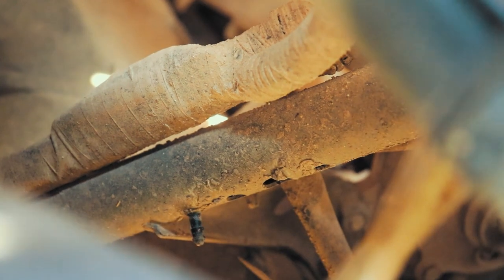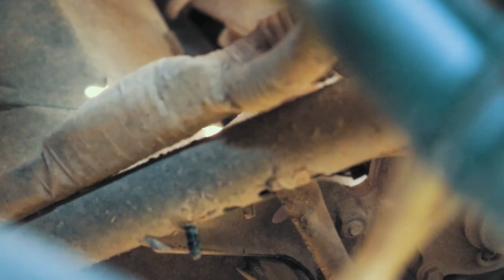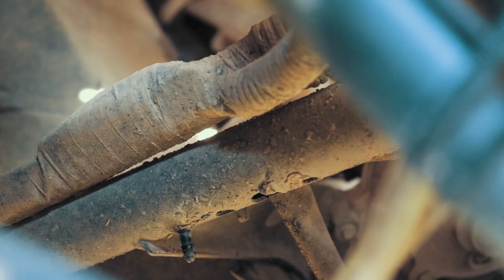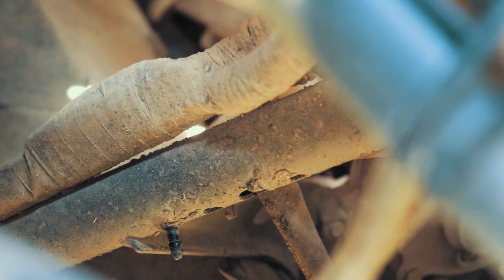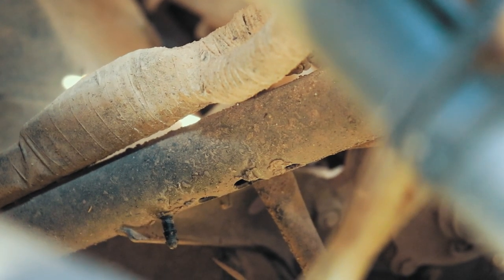That's actually a little plastic barb that goes inside that frame. Right there is what I'm talking about. Now, before you put the snorkel on and you're looking for all these vent lines, there will be a black fuel line, essentially. Sorry about that. There'll be a black fuel line running from the passenger side underneath its seat. It'll run up and it'll be pushed into that. So all you gotta do is just pull that fuel line off there.